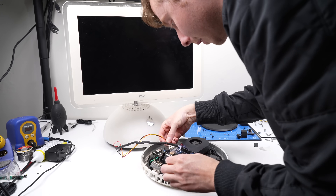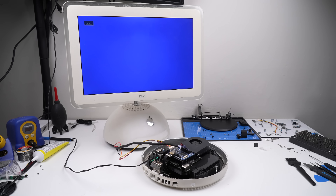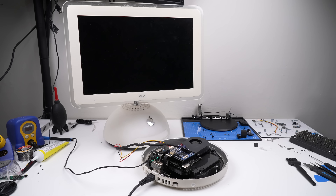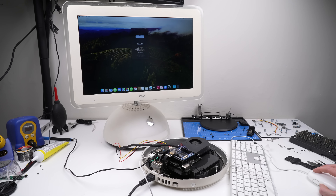Now all that's left to do is get the display cable attached to the control board with a 12 volt power source, which for the moment is coming from a power adapter. I can now press the power button - but the fan didn't spin up, I heard no chime, and nothing is showing on screen. I then realized I didn't attach the speaker - it did in fact boot up.